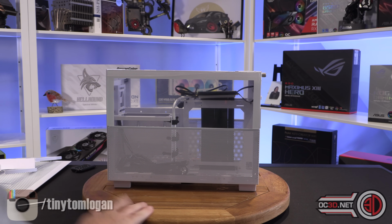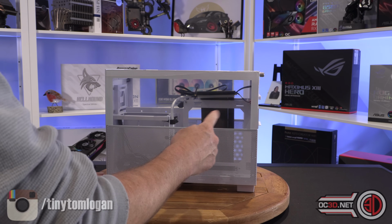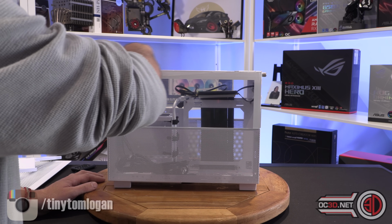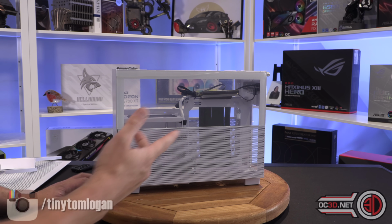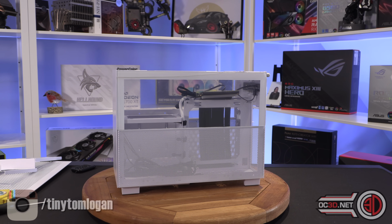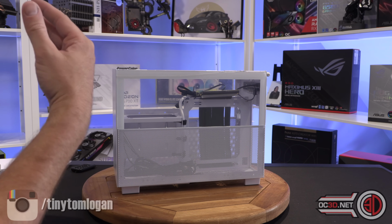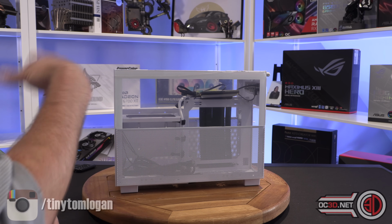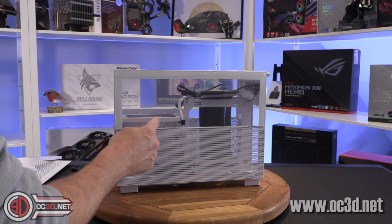So you could have, let's say, if you've got the money, a 3080 Ti down this side, you could have a 5900X down in this side, off of a water cooler with a 240 or a 280mm AIO in the roof. And even if you keep the SFX power supply, you can get 750 watt SFX power supplies now. So I actually think that you could cram an awful lot into this as long as you pick your hardware correctly. So I'm definitely saying get one of the SFX, Corsair do them, Be Quiet do them, I think Silverstone still do them as well. So you've got quite a few power supply options, and I definitely would keep this one.